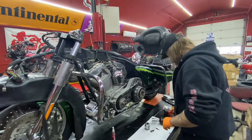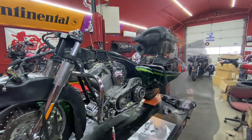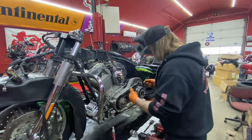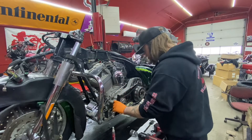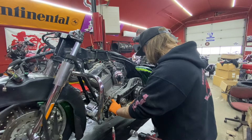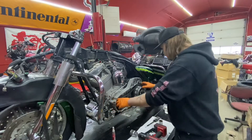When you're measuring, you want to pull your chain towards you on both sprockets. Then you want to lay a straight edge on the outside of your inner half and measure from there to your chain. This one is bang on.